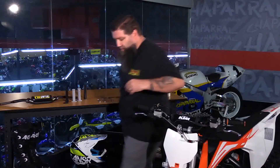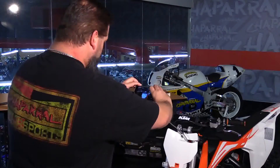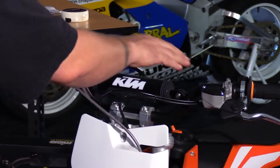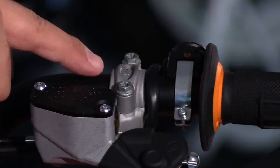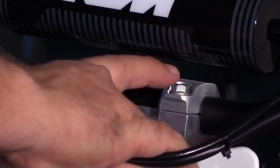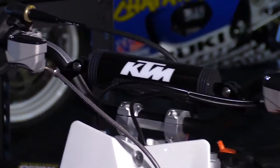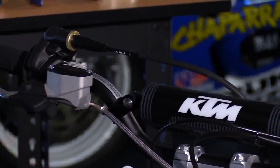Just use your cell phone. Along with the cable routing, you also want to take photos of and take note of the control clamps and the bar clamps. Over here on the top it says 'up,' so when we reassemble these we want to make sure this is pointing up, which will be forward. On bar clamps, sometimes these are indicated by a little dot or an arrow as well, so you know which way to face the clamps when you reassemble them. Once you get all your pictures taken, we can go ahead and start with disassembly.